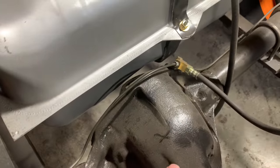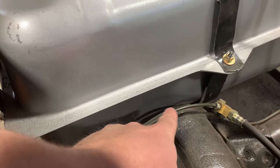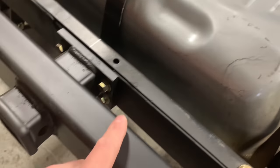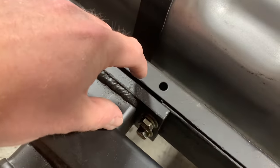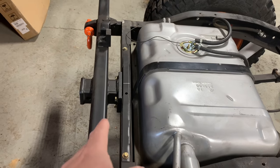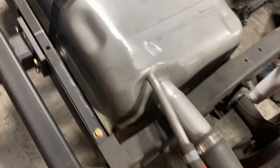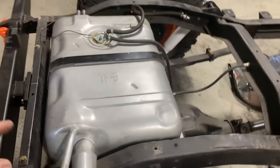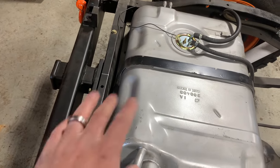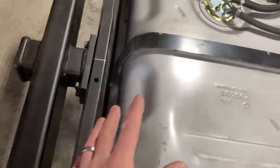So I think the first thing I want to do is mark anywhere I think it needs clearance, because I'm probably going to end up cutting a chunk out of this and welding it up to make clearance. Now I do have this space right here between the rear crossmember and the bumper — I could take all that out and that would shift everything back about an inch and three quarters. That's going to involve a lot more work though, because I'm going to have to modify my bumper and cut this rear crossmember out. So I think I want to stay away from that idea for now. I want to see if I can make this work the way it is, even if that means getting rid of the factory skid plate and building my own, because I do have all this room right here I can use to make up that distance.